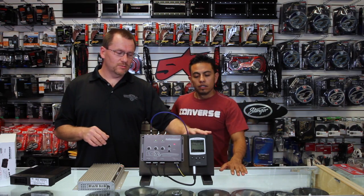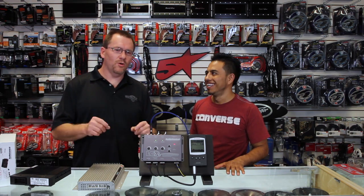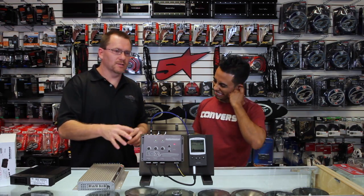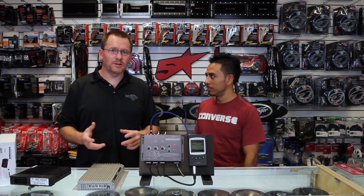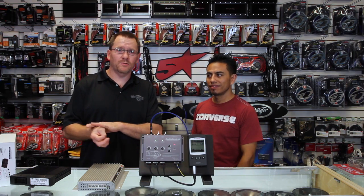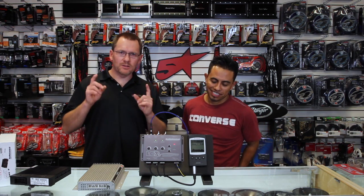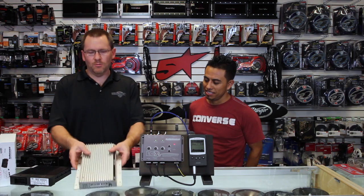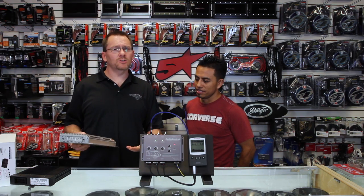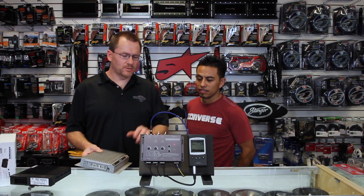You don't need an RTA — it's nice to have. These work really well for tuning, and if you want one, it's called the PPA3 — pick one up, it will make your life a lot easier. Your ears will work fine too. And if you start testing your speakers and each one is on its own channel, chances are good that speaker is actively crossed over from the amplifier, and you're going to want to bring them together. This is a great device to do it.